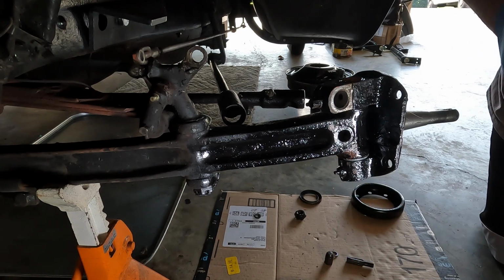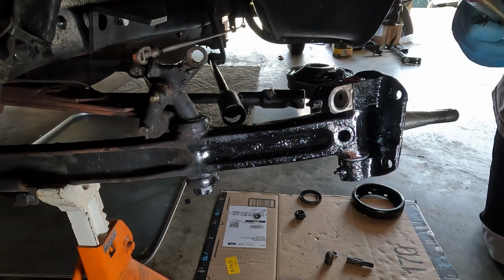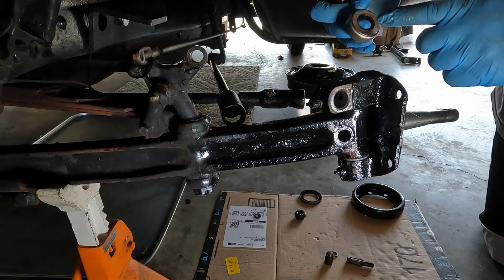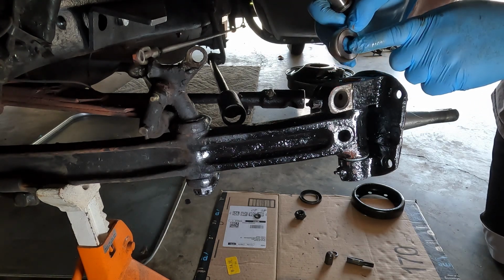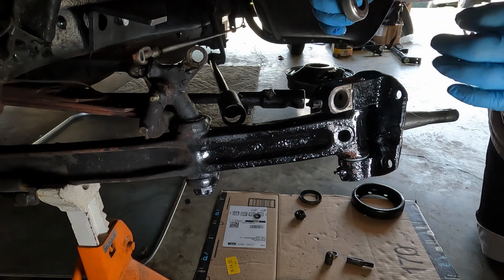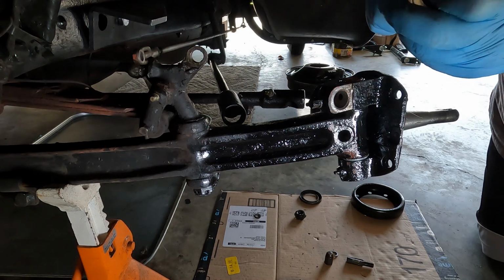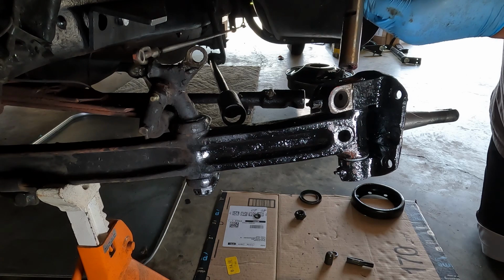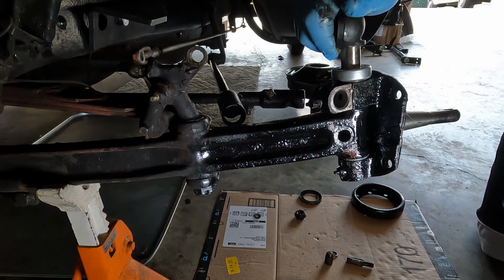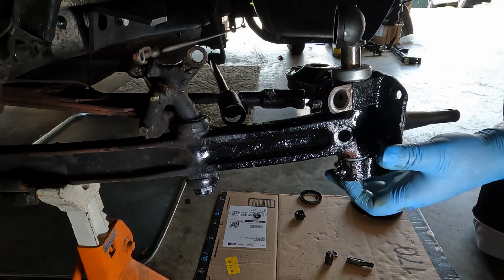All right, now we got our felt washer in, and we've pre-lubed the kingpin bushings, put a little grease on our kingpin as well. I also made sure that the bearing is packed. I checked everything before lubing it all up, making sure that we had enough spacers so that when we install the kingpin in final assembly, the car weight is resting completely on that bearing.